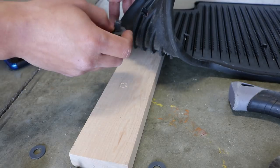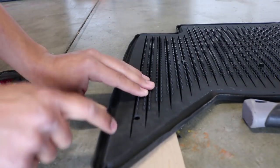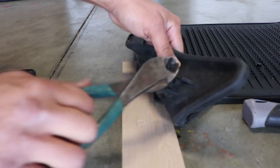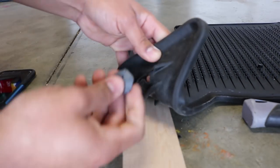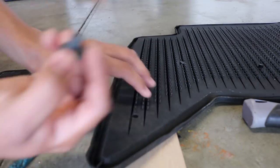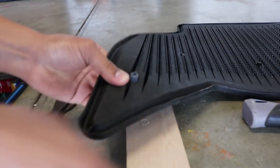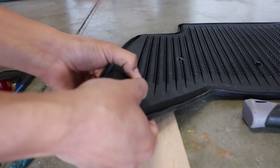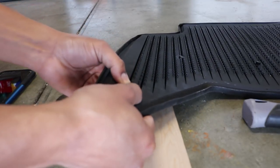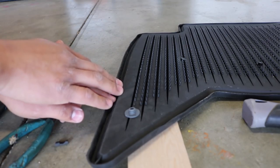The next step — let's go ahead and flip it to the upside and pop the screw right in. On the rear Tacoma floor mats they are a little bit thick here, but there's no worry — you're still going to be able to get your screw in there. It just takes a little bit of custom work. So you're going to notice there is threading on the screw here and at the bottom there's no thread. Go ahead and put your screw in just like that. Once you have it in position, get your washer that is provided and put it over the thread just like that. Try to get it all the way to where there's no more thread, but if you can't, don't worry — I'll show you why in a minute. We're going to leave this for now. I'm going to do the opposite side of this floor mat and then show you the next step.